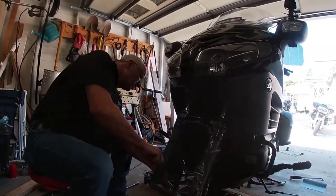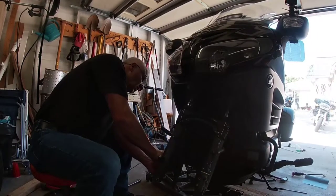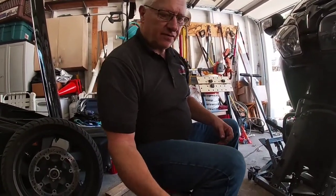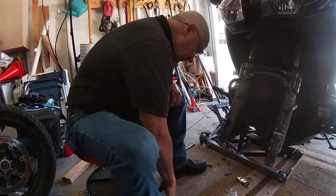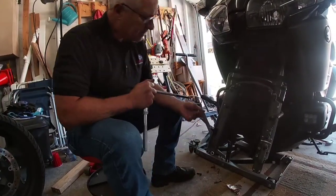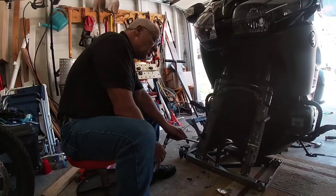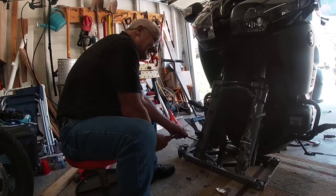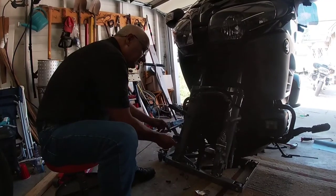There's a little rubber-coated thing at the bottom of your brake caliper — a little cover, just like that. That comes off your caliper. And I just use a hex, go in there and get it. You just loosen that hex bolt and that bolt will roll right out. Those pads will drop right off. Just pull it out all the way.